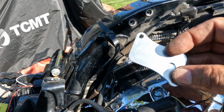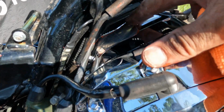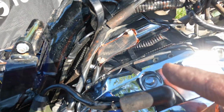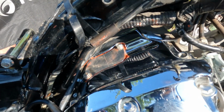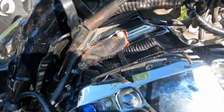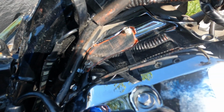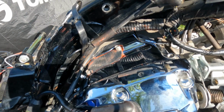It just lays in there and blocks off that plate now. A bead around here of the gasket, make sure it's sealed. Well, that's pretty much it. Once you get your screws back in, you make sure you put a ridiculous amount of gasket sealer on there so it makes a mess. Good thing is it just wipes right off of there, especially when it's still wet. I wouldn't try it when it's dry, so wipe it up and get it cleaned up as much as possible as soon as you get done.